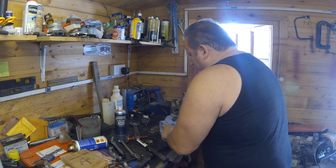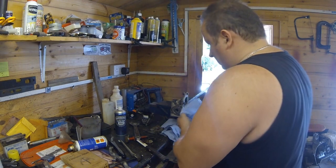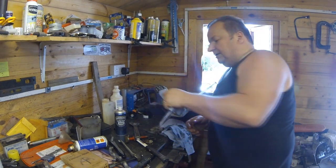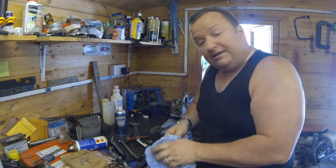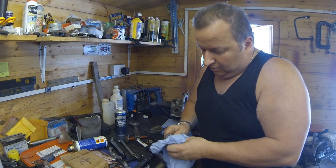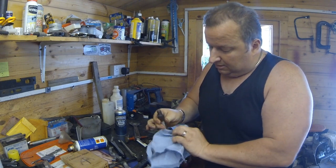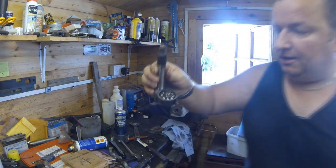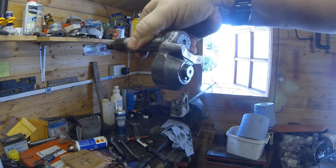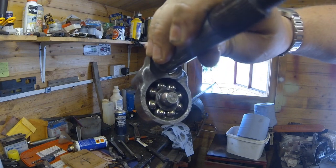That went with a ping — let's get that shaft out. I decided to actually get it out anyway — I wanted to be double sure that everything was going to be okay. Plus I want to clean the casing. So I thought I might as well do it. That was tough to get off — no way you'd get that done without a puller. So you needed a puller to get that off. Everything seems to be in good condition there — there's the bearings under the steering head. All the bearings are in situ and they all look in good condition.